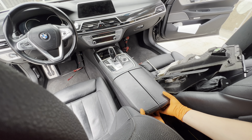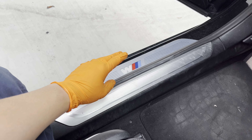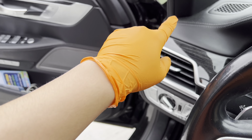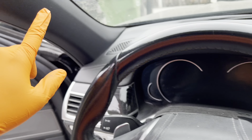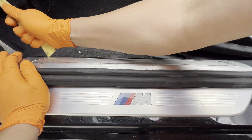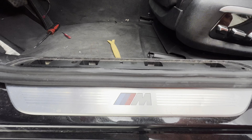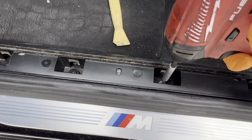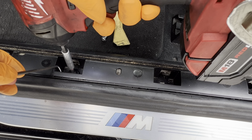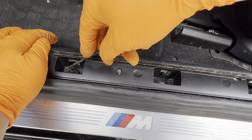From the back, lift up and slide back. What's left is to remove the panel here, the kick panel down there, move up along here and remove the A-pillar trim — then do the same thing on the other side. There's a T20 here, and this plastic T20 is a bit destroyed — let's see if it comes out easily.